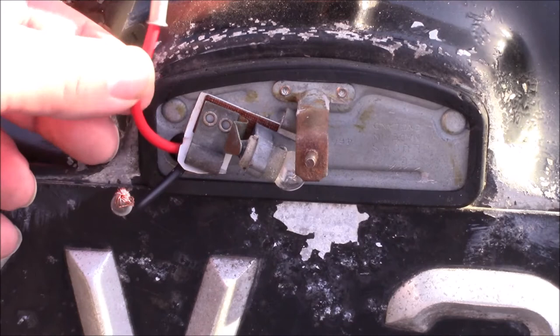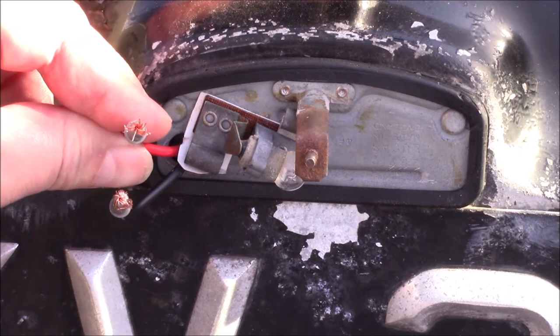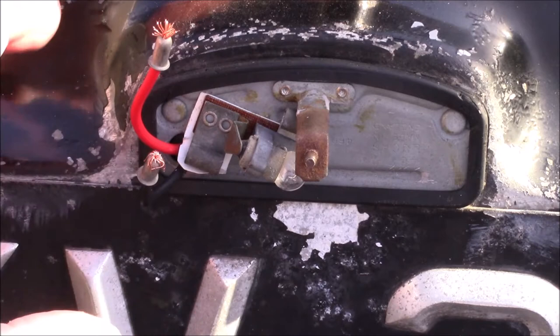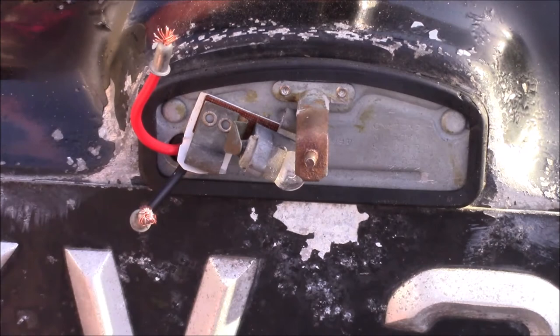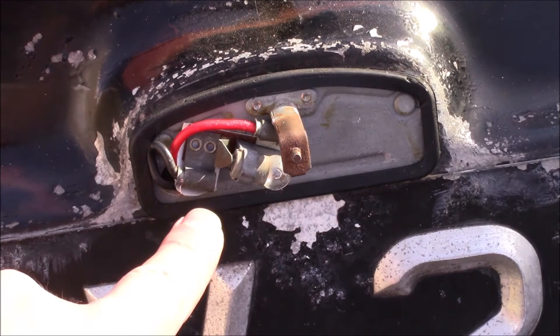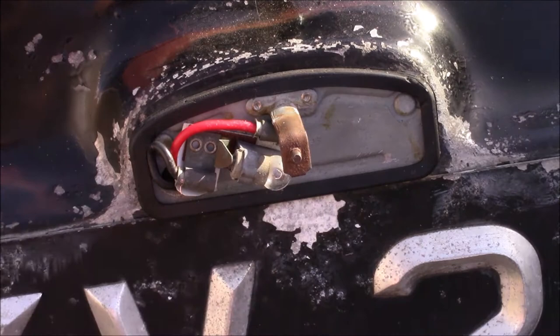And what you do is you strip the end of the plastic off the wire and then poke the wires through a hole in the top, and you bend the wires down over the thing to hold it in place, and that's it. You can, if you want to, solder on the end of here. I'm going to try it this way and see how it goes. If it works, it works. You just plug them in. And there we go. There's not a lot of space to work with at this end, so it's a bit of a battle getting all of these wires lined up. Pretty sure that's the correct way around. I'm not sure it makes a lot of difference when it's just the bulb. Pop the cover on, and then we'll see about putting the interior trim on.